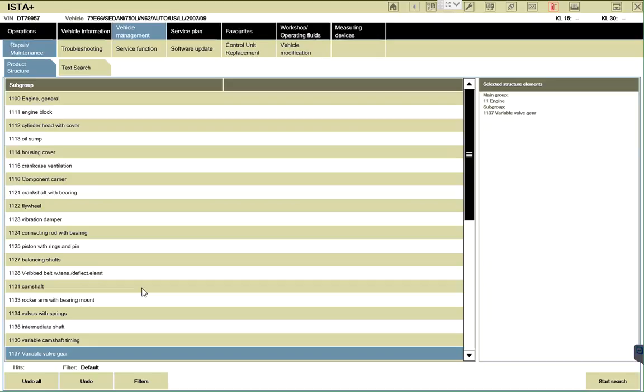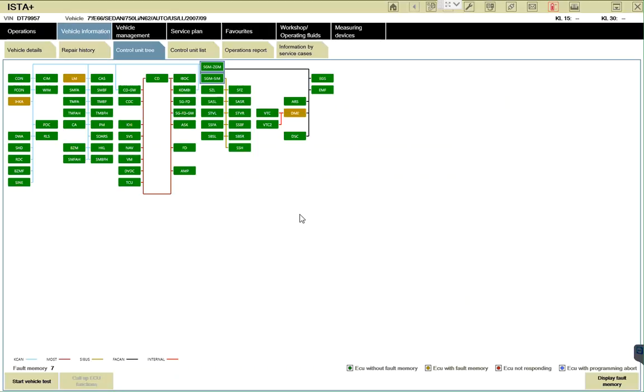Okay, YouTubers, end of this vehicle session for now until the owner gets some solenoid valves and probably a chain and a tensioner to set back the timing properly, because there's an offset to the cam to crank, so therefore there's also an inlet valve problem. Could be a dirty valve, contaminated valve, or dirty oil, you never know. Or the eccentric shaft position sensor probably not installed correctly. So probably 2 to 3 or 4 things need to be corrected first, probably 2 mechanical, and then it will solve the other ones that have to do with the software side of things.